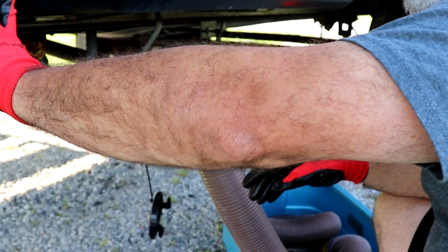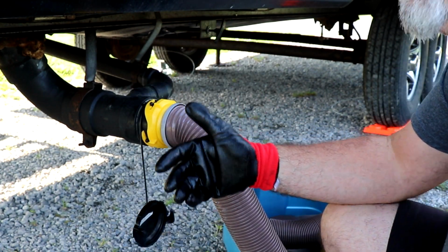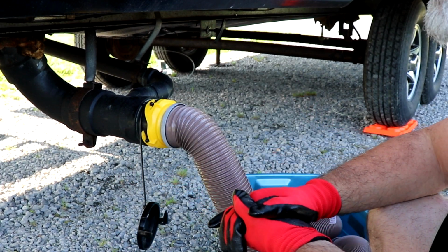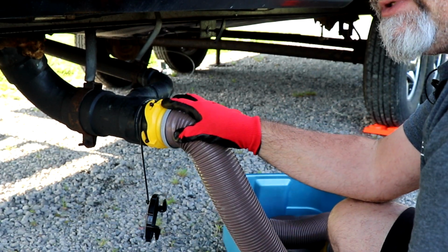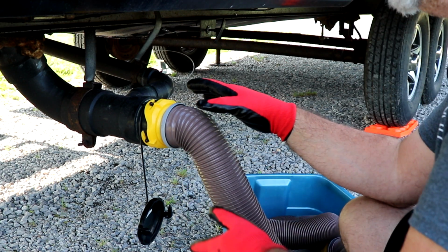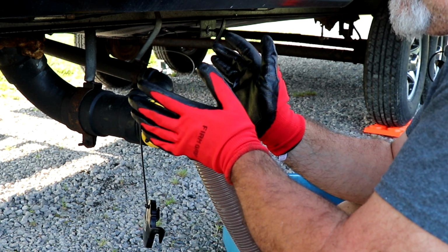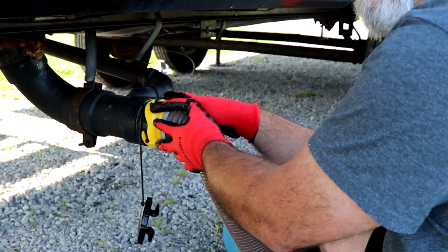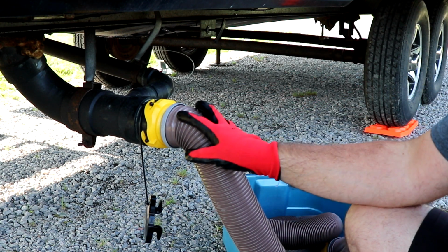Now, on your unit, depending on whether you have a rear bath, a front bath, or two gray tanks, like our unit has 2 gray tanks, the manufacturer hooks them all up to one dump station, versus some manufacturers these days that have 2 different dump stations. You may need to either get a second set of hoses with a Y connector to run both over to one dump station, or dump one set of tanks, unhook, go over, and set up your second set of tanks.